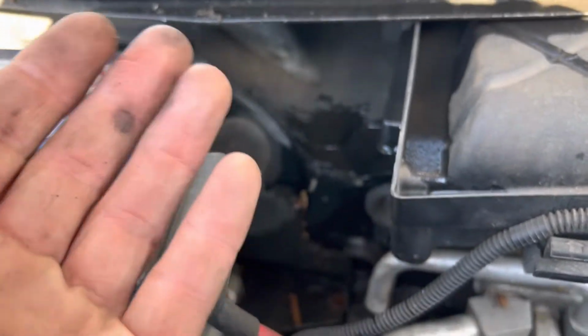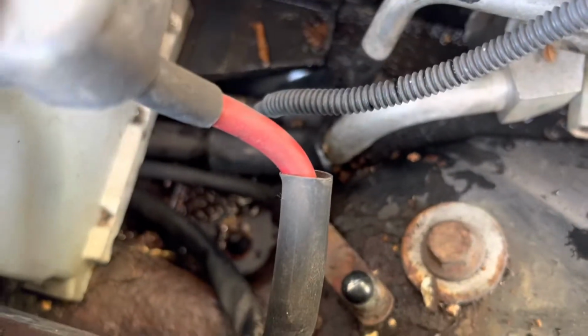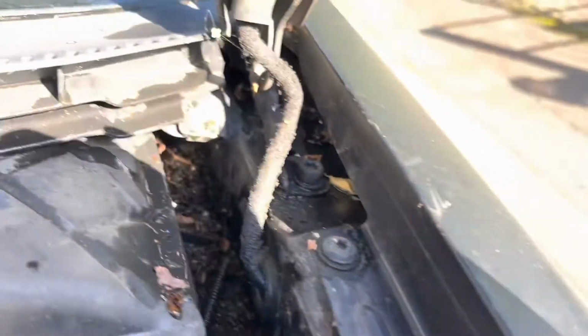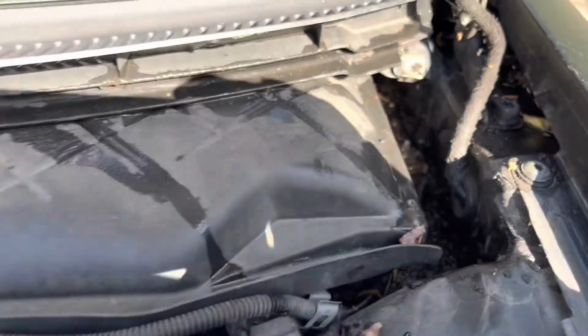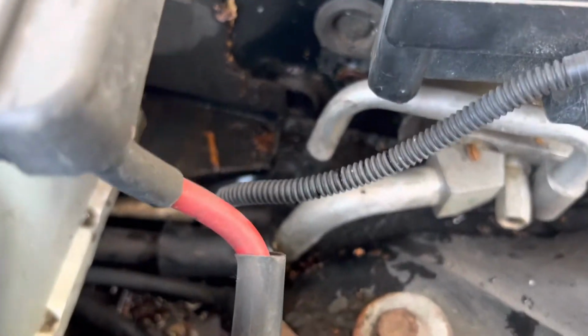And you can see on this car there are big flakes of rust like this just sitting in that area. So my advice is, if you've got an Audi A4 cabriolet, or in fact any other Audi, just pop that bit of trim off and have a look and make sure that that drain hole is actually free from leaves. And if you have got a whole load of leaves here on this side and on the other side, we're going into winter and it's going to start raining and snowing, my advice would be just to clean them out,